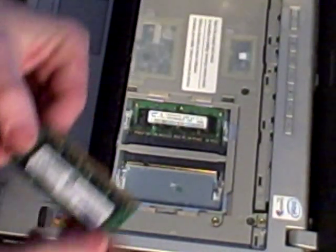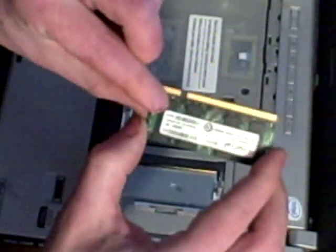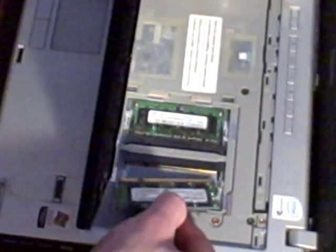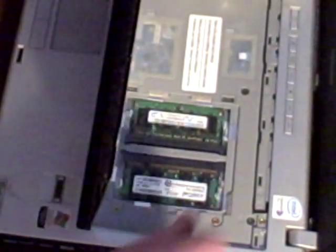So that's one, and I'm going to stop right here and put in the new one as I go along. The originals were 512 megabytes, so two of them gave us a gigabyte, and I'm replacing them with these Crucial modules which are two gigabytes each, which the notebook is supposed to register. You can see the notch here — the notch is used for aligning, and you can see the notch in the module slot. So all we need to do is insert that in there, make sure it's in good, and then press it down and click. There it goes in.